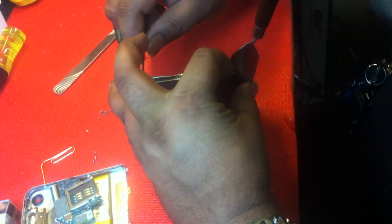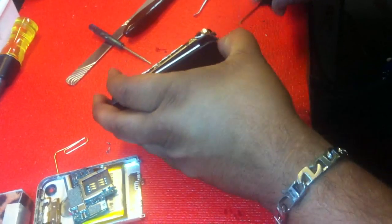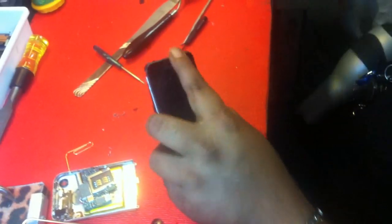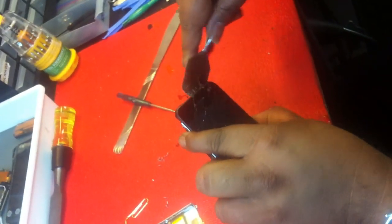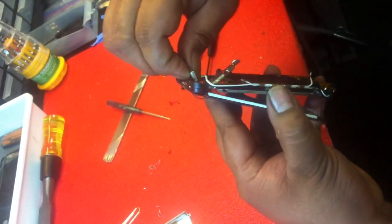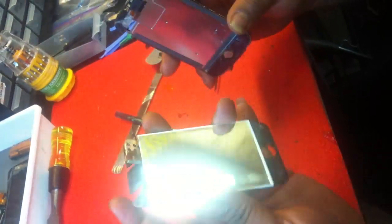This side's done. Then I'll get on this side of the home button and pop these out on this side: one, two, three. The home button will fall out — there's the home button. I'll heat it back up on this side, get my flat tip again, and slide it underneath here. The bad thing is this is where all the cracked glass is. I'll flip this out and push this whole thing out. You've got all these cables coming out — that's your bad glass.